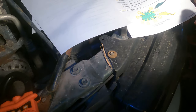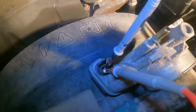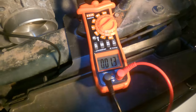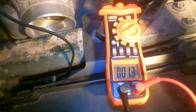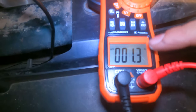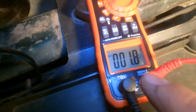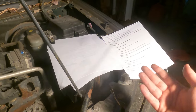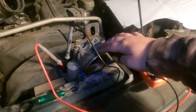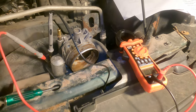Now we're testing the TAC motor. We go to pins E and F and look at the ohms reading — according to the guide, between 2 and 13 ohms is a good result. On the one I took out of the vehicle I'm getting 1.3 ohms; the guide says anything below 1 is a sign of short circuiting. I'm below what they say is acceptable, so I'll do this same test on the junkyard one. On the junkyard unit I'm reading 1.8 ohms — still below the 2-ohm threshold but definitely looking better.